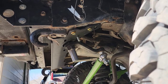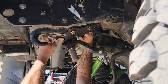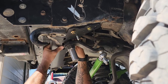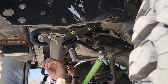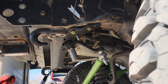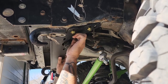Okay, steering box is loose on the frame, which gives me a little bit of room to wiggle. And I'm thinking — oh, that was the ticket this whole time. Now that thing's gonna tighten up real nice. We got plenty of wiggle room on the frame here. I finger-tightened these bolts just a bit too much, especially that one right there. Let's find my socket. There we go. Now everything's got a little bit of wiggle to it — see? So since we already have this bolt started, let's see if we can get this thing started up in here.